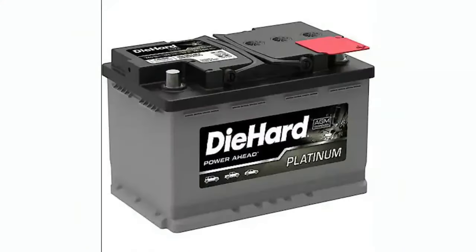The battery in a car with an internal combustion engine just drives the stereo, headlights, blinkers, and so on — it isn't what actually runs the car itself. These batteries are basically 12-volt lead acid batteries. They're big, heavy, last about a decade, have big lugs, and provide just positive and negative terminals. Your internal combustion engine charges the battery, and if you let it sit and it self-discharges, you need a jump start to get going again.